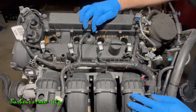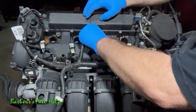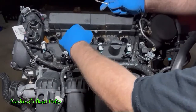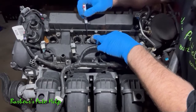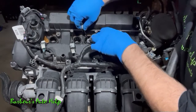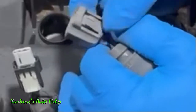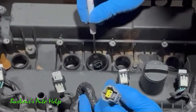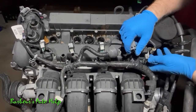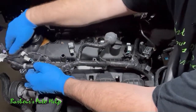Now we need to disconnect our cylinder head temperature sensor which is right up under here. Pull this cover back a little bit — it may help to put a little pocket screwdriver down in there to pry up on it. Be kind of gentle when you do that. Inside there's another electrical connector with a lock tang — push in on the lock tang and pull up on the connector to release it from the cylinder head temperature sensor. We also have another stud to remove the harness from right there — pull the harness up and push it out of the way, tucking it behind this little eyelet.